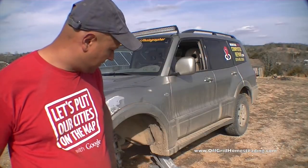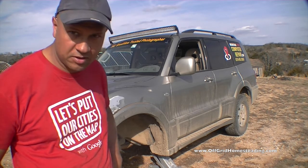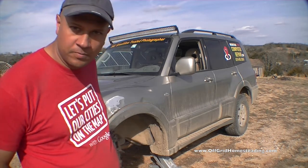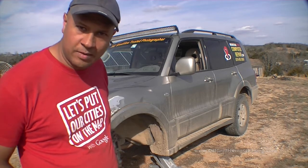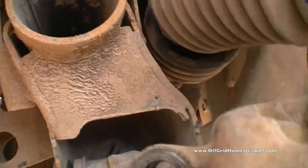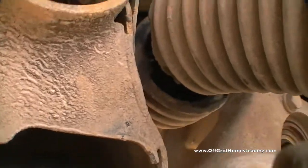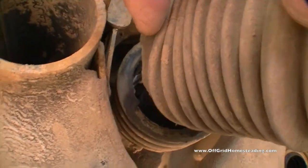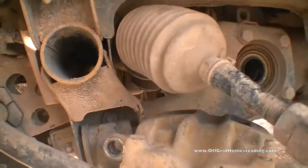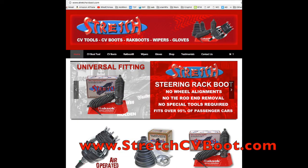I'm going to actually measure this to see if it will actually fit and be the right size for it. I might be able to use this one. The other issue I have is down here — on the rack and pinion, there are rubber boots right at the end of the rack and pinion that go over the tie rod that actually steers the car left and right. Anyway, this one's broken or torn. Nobody sells the boots — there's no boot kit for it. You can get this rack boot out of Australia for about $30 for the boot and $35 for shipping.